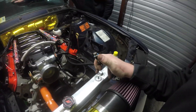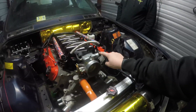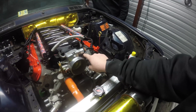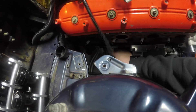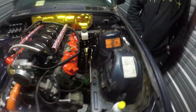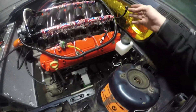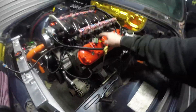On the truck, all you really need to do is adapt the IAT so you don't use the stock MAP, then TPS, no idle air — idle air control and TPS, that combo. All the way down here on the passenger side of the block we have the cam sensor, coming back over here we have coolant temp, and this should be for knock — which I don't have right now, so we're just gonna send it. You got your coil packs and injectors.